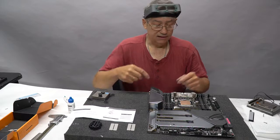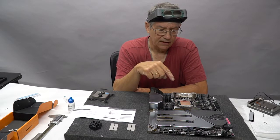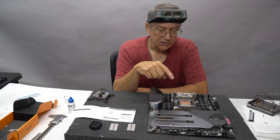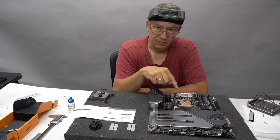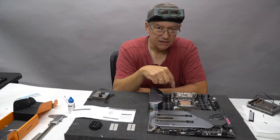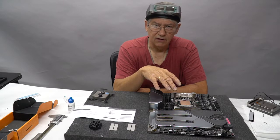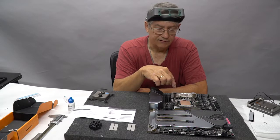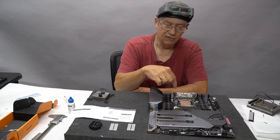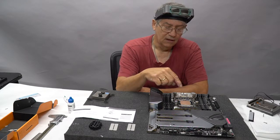So the way we're going to set this up is we're going to have water coming into our CPU out of the pump. So that will be our first component cooled. This is the one we're most concerned about. Then after the water leaves the CPU, it will go into the VRM. The VRM has a tendency to run much hotter. So if my CPU, I want, it's down in 30 degrees and my VRM is up to 50, it makes sense to cool the CPU first. I don't want to preheat the water in the VRM and then run it to the CPU.